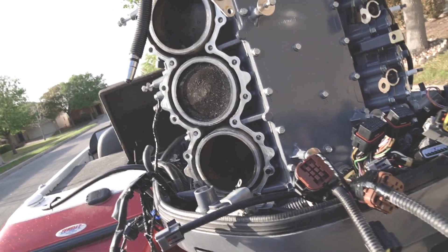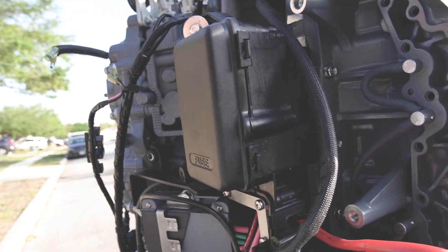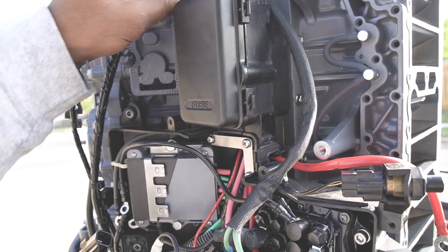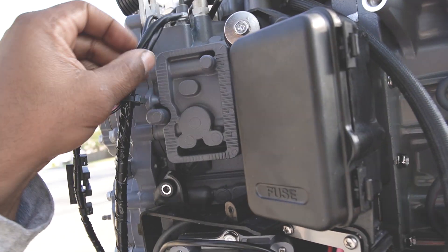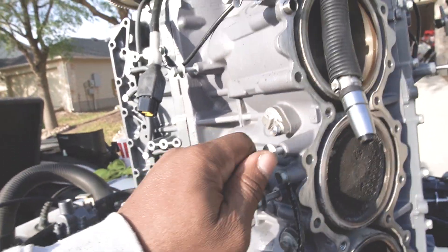That's the stopping point for today. Tomorrow we'll get it off, remove the little bitty things, and put the new one on. Here's a little tip: if you're not good at remembering stuff, you don't always have to put things in Ziploc bags and label them. What you do is when you take something off — say this fuse panel — just put the bolt back in the hole. Here I have two grounding wires that go right here, I'll put the bolts back so when I come back and have wires left over, I'll just go to the old block and know where they go. Put the bolts and nuts back on — it makes it a lot easier than trying to remember, and you know exactly where they go when it's time to put everything back together.